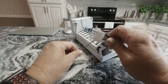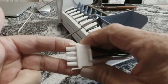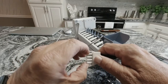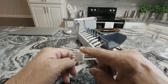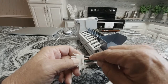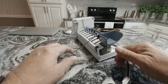When you go to do the wire harness and unplug it, you can see these little clips right here — they're going to have to be pulled up and off of the harness itself so that you can pull this plug out. You won't have to mess with these a whole lot when plugging back in, because they'll slip over the little keepers and snap into place. Just make sure you're getting it plugged in correctly. Before you pull the old one out, note the wire color order: black, brown, green, and white.